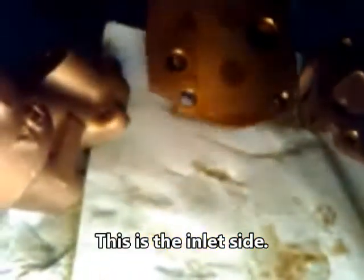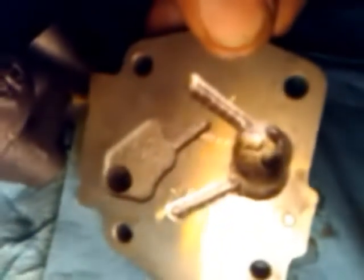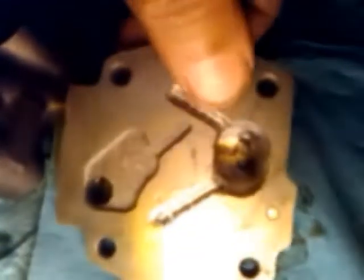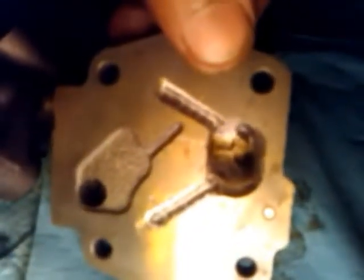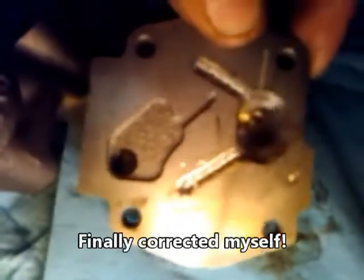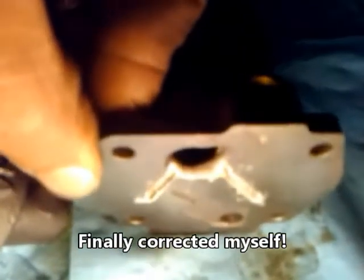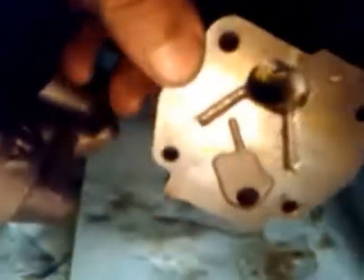Here's the bottom plate of a stock pump — there's the outlet hole right there and of course the pressure relief. Lingenfelter also recommends cutting these grooves along the outlet on this side. I went a little crazy with the stone and radiused the hole out a little more and smoothed it out, because if you take one apart you'll notice the bottom looks like they just took a plunge bit and plunged it down in there, making a deep pocket that would disturb oil flow as it exits. So I went in both sides of the oil pump outlet/inlet and smoothed it out — radiused the transition as you can see. There's no exact science to it, just smooth it out.